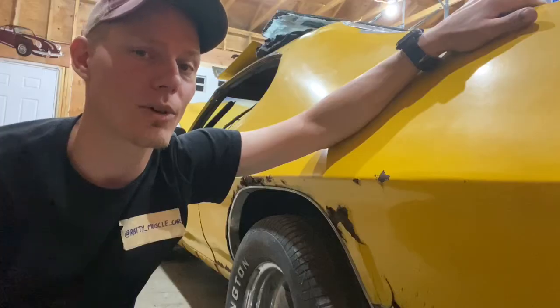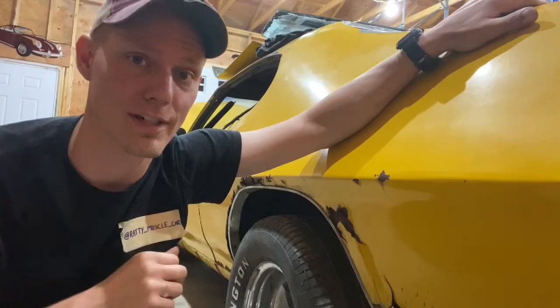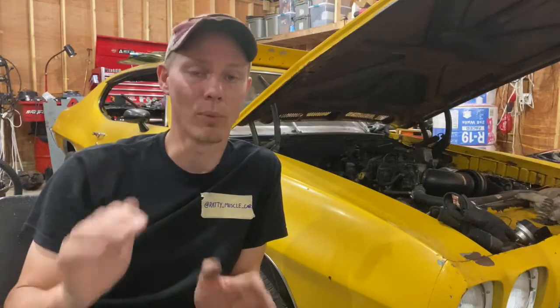You're probably saying, okay, how do I know which parts actually work together and which ones don't? There are two different ways to do it. The first option is to just buy a brake upgrade kit for your car. It comes as one unit — hopefully somebody smart put it together — so you know it's all sized properly and you can just bolt it in, put the fluid in, bleed the brakes, and all will be well.